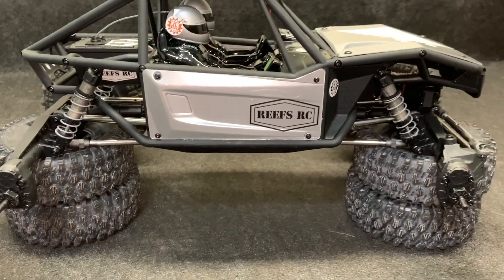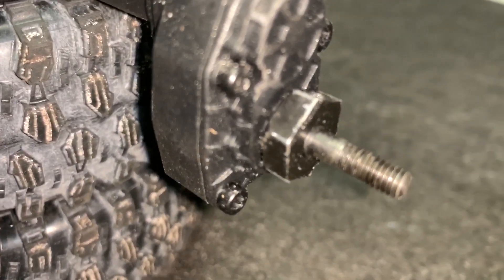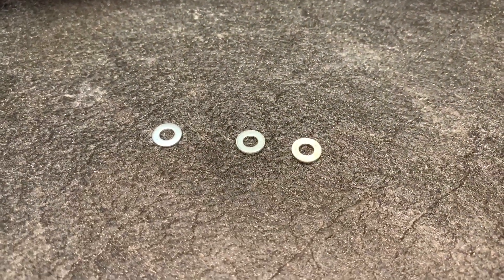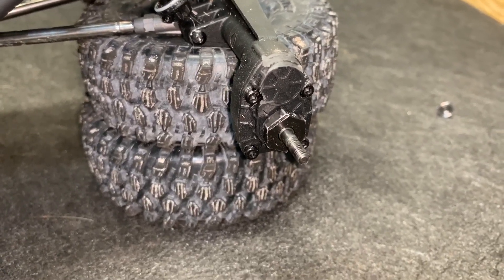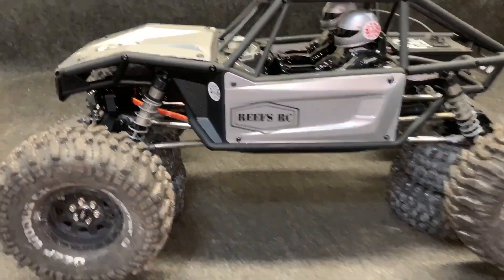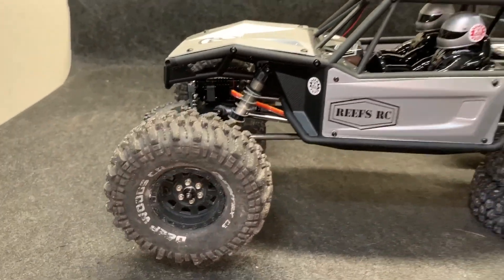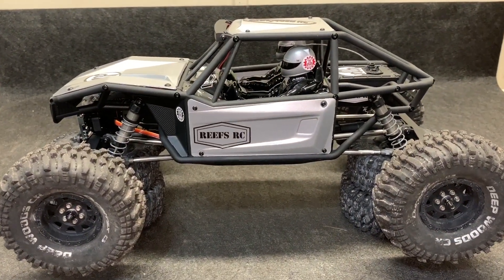Or they'll just make it worse. The other issue I'm finding is that shank right there — the part with no threads on the axle — is actually so far out that I'm having to shim the outside with washers so that the nut will actually tighten down. Those threads could go back a little bit further. When you get the tops of the portal gears clearanced, the tire should just move nice and free. When you get that, you're good to go — hopefully you haven't messed up and ground into the gear area.